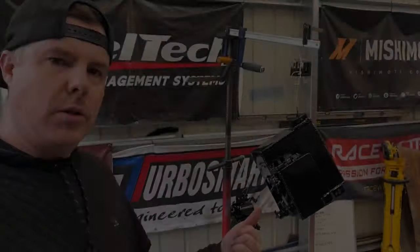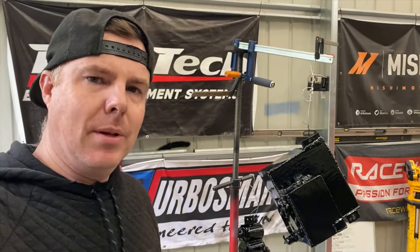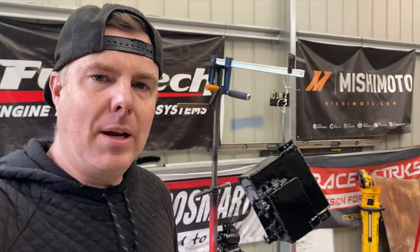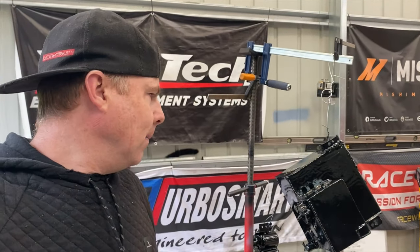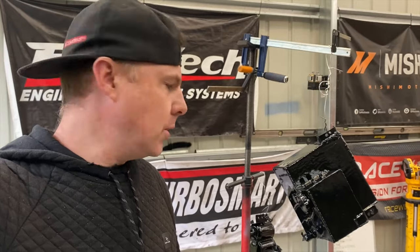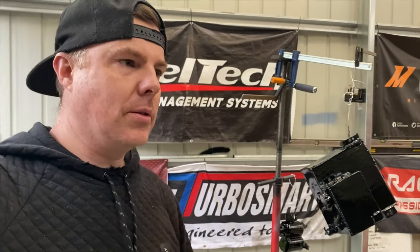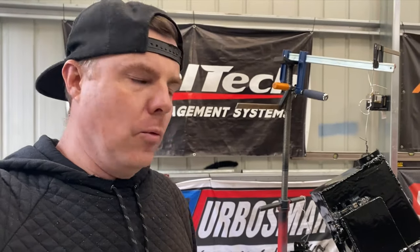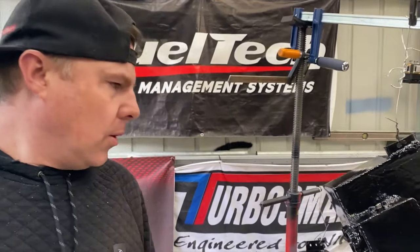Fresh off the gun — it was meant to be satin, so I used undercoat then satin black rattle can, but all I had was two-pack gloss clear, so it's ended up pretty glossy rather than satin. I like painting things like this these days; it's made a massive improvement on the lifespan of what I paint. I used to use rattle cans alone and chemicals would wash it off in no time, but this setup with 2K clear over the top of a 1K colour really works well.